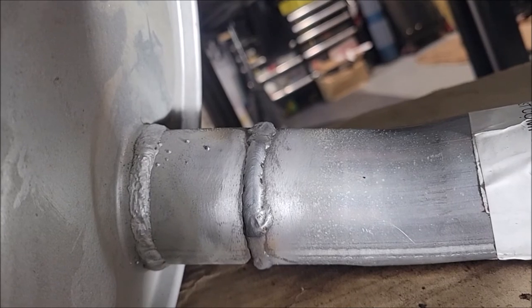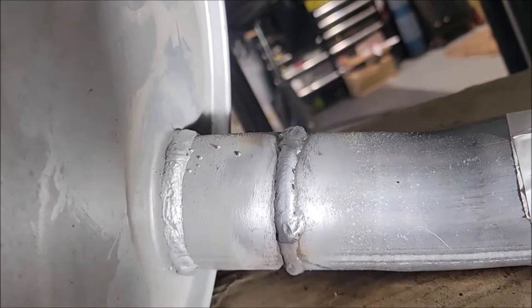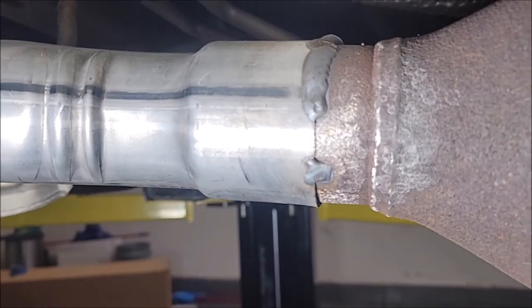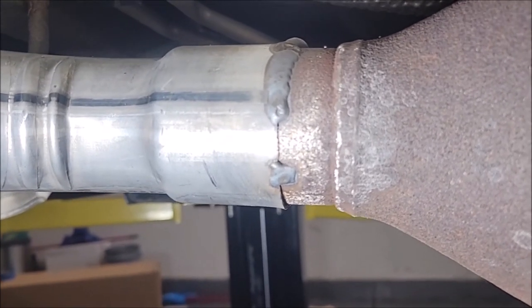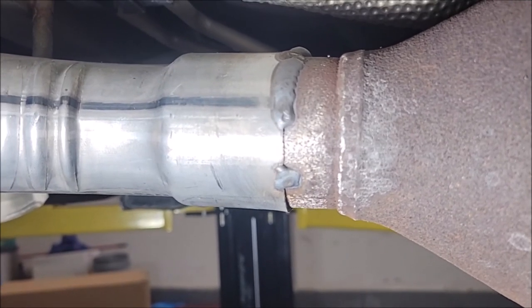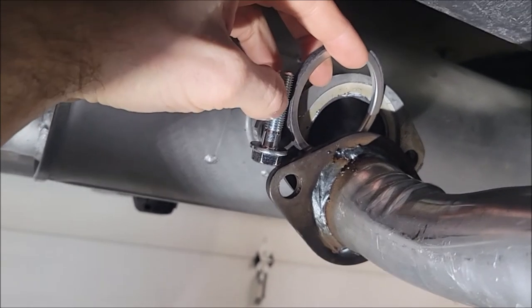You have to drop the exhaust for your last weld to keep it straight, then get your nice bead over the top and close it off on the side where you started. I was feeling lucky today and decided to weld that rust — it's welding pretty good. I'm doing a little at a time and letting it cool because I don't want to blow through that old metal. Slip in the crush gasket — it's M10 by 1.25.